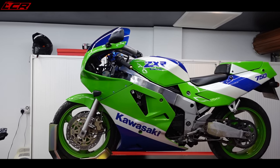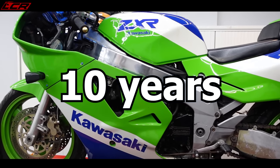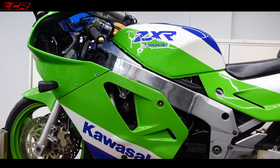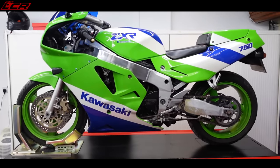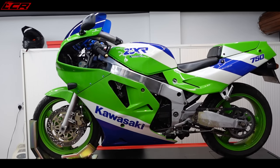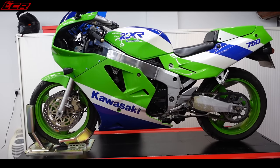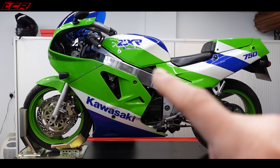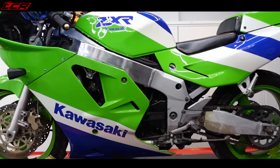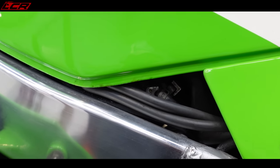What I may do to start with, because this hasn't been started in 12 years, is see if it will run. I can't put it away and forget about it without knowing if it's going to run or not. So I'm going to take the tank off, take the carbs off, clean the carbs, change all the fluids, and see if it will start. The throttle cables are seized, the choke cable's seized. It could be the actual carbs — they're all gunked up. I don't know, it could be the throttle tubes are just seized because they were left with fuel in them.